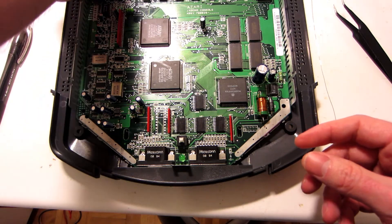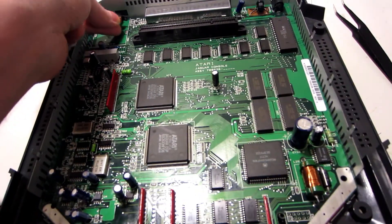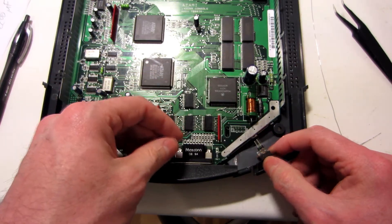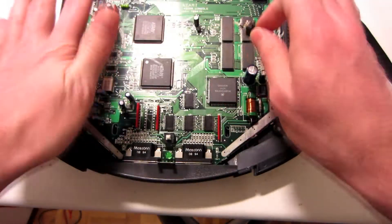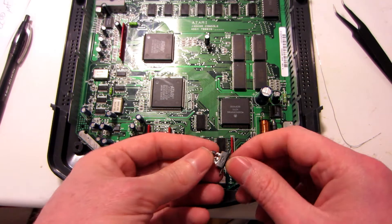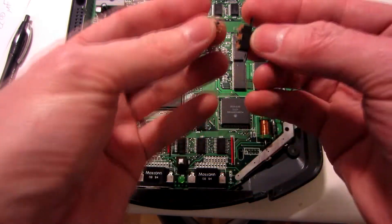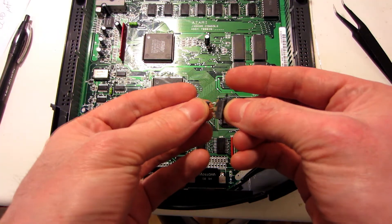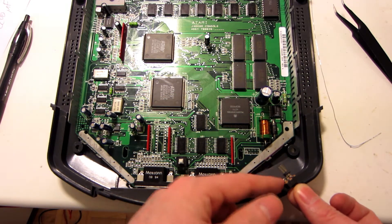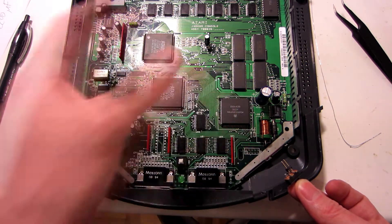Then you link the two wires to a switch like this one. Most modders put the switch on the TV tuner hole on the back of the console. But eventually I'm going to put it somewhere else, because when you put everything back together, the big metallic shield on top means I won't be able to access the switch if it's in the tuner hole. I'm going to use a Dupont connector and solder it like that, so when the switch is fixed — I think I'm going to superglue it — I'll be able to unplug it and free the motherboard really easily.